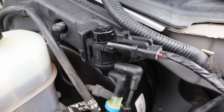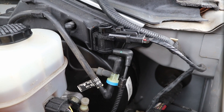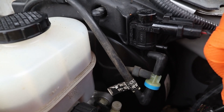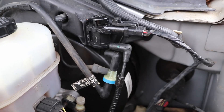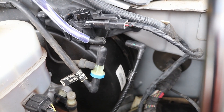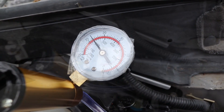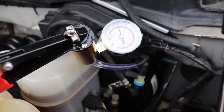We're also going to hook up a vacuum gauge to see how much vacuum we're actually pulling. With the truck started you should be able to pull this line off and hear vacuum if you're in two-wheel drive. With it plugged up to the vacuum port, the reading we're getting is almost 25 inches of mercury — that's more than enough to run the system. That tells me the back half of the system is working properly and we don't need to worry about that.